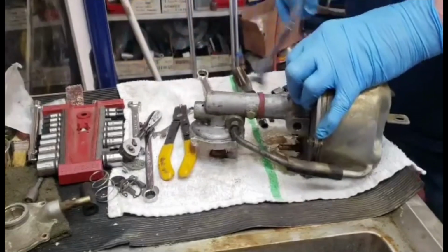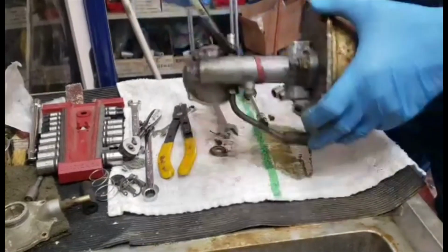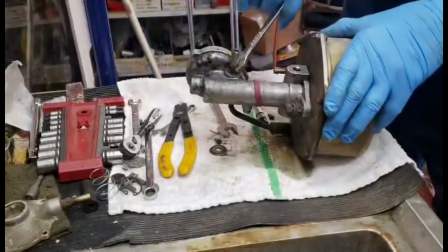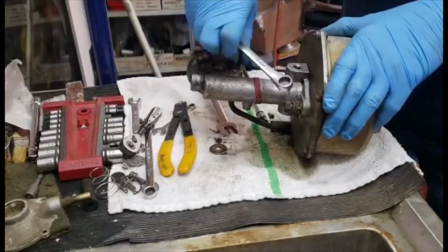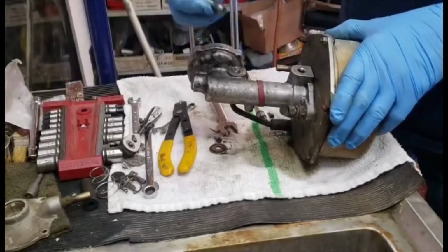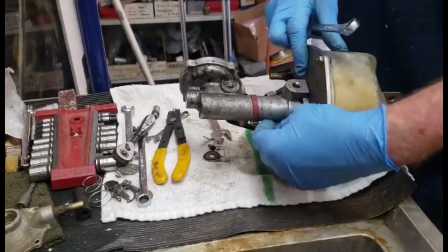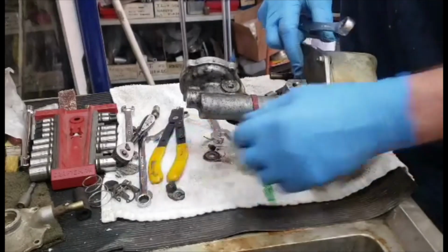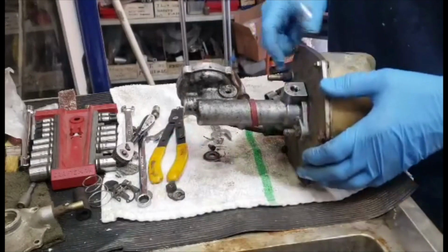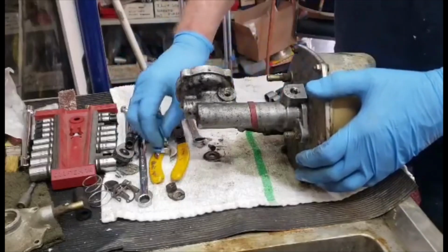this is a 12. It's only on the coupe. The coupe's got this vacuum hose on this side. On the sedan, it's got the vacuum hose on the other side. And this is a common similar booster to the one that's on the late model sedan. So if it had one line out instead of 2 lines out, it would be a sedan body. That'd be the way to tell.